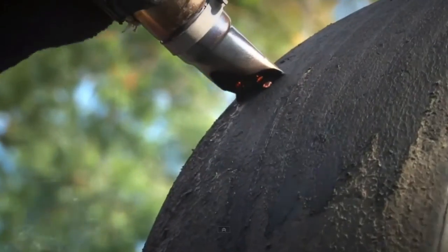The other problem is that because you're putting the tyre through a heat cycle, you're effectively drying the tyre out a little bit every time you use it. Tyres have a longevity, and the more you dry them out, the quicker they age and the quicker they lose their stickiness. So there is that element that you're kind of rapidly degrading the tyres.